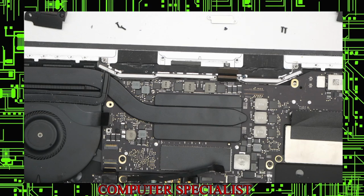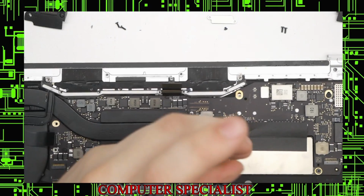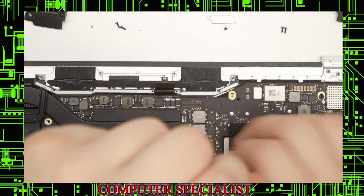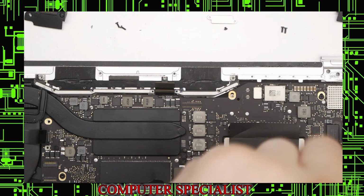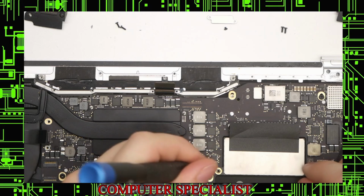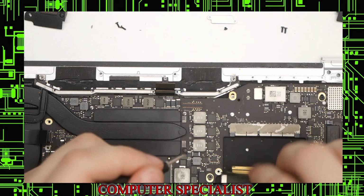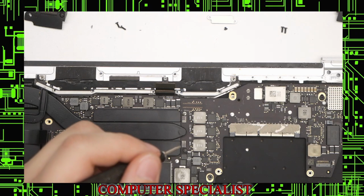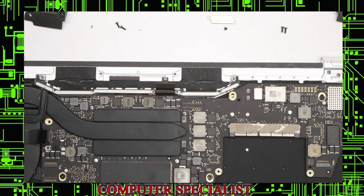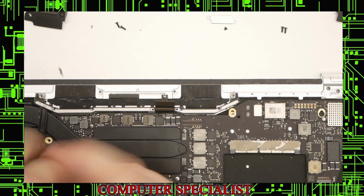Okay, now we can take out the motherboard and the hard drive. This one has one that's removable. So we'll take the drive out first. And this you can pull by the screw connectors, and it's in a socket, so it just pulls out just like that. The screws with that. And now we can start taking the motherboard out finally. Again, we can use our T4 bit.